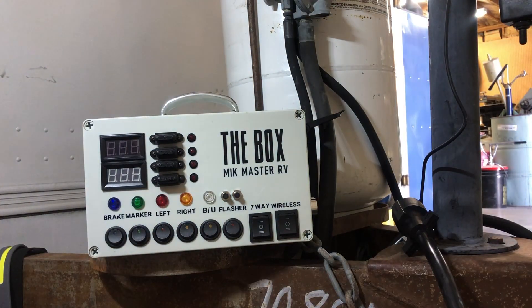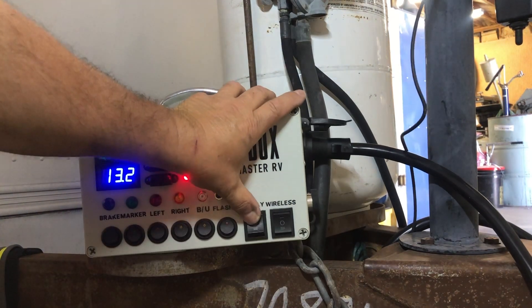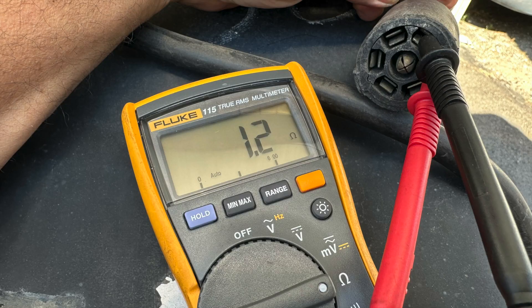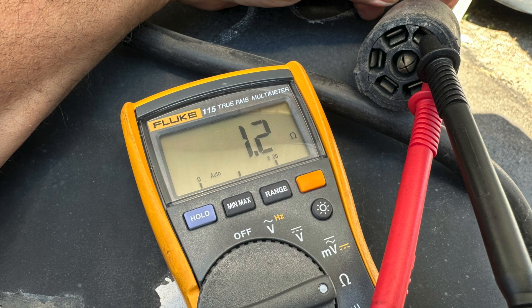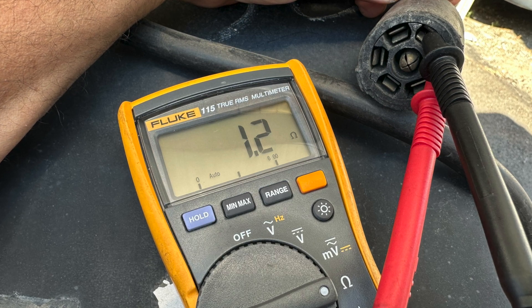I'm testing the brake circuit with one of my boxes. I'm usually going to see maybe around 11 amps. If I start to see something below 8 amps, that's when I start to get concerned. As you can see here, this trailer we've got 11 amps and the volts are a little bit low. That's when I get down and check each one — inspect it physically to see what's going on.